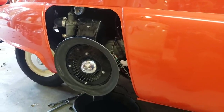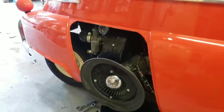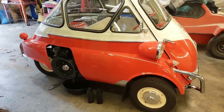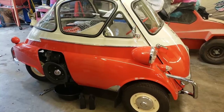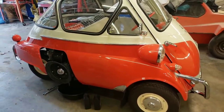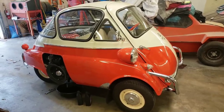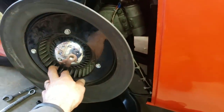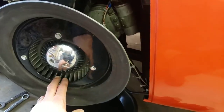I've done all my tests. It starts and charges just fine, and that's been a real Achilles heel with this car since the customer has owned it. I think it had a broken wire someplace in the Dynastart — I never really figured out where — but it was always a slow starter. It would get to the compression stroke and the starter would just stall. You'd have to get out of the car, open the engine cover, and rotate the engine by hand to get it off compression stroke, then go back in the car, turn the key, and then you could go.